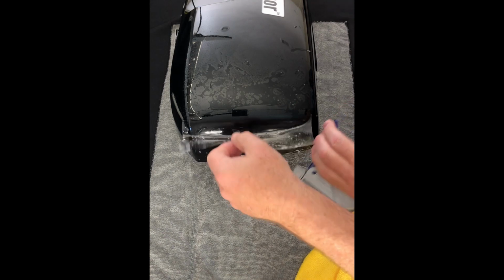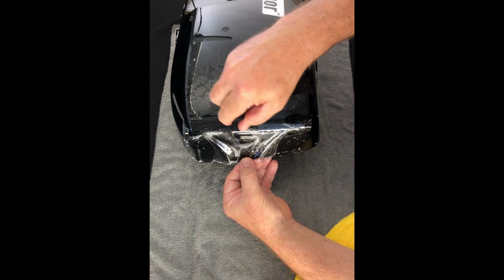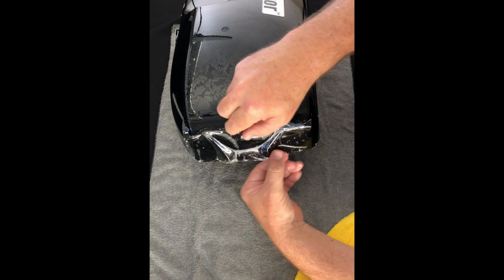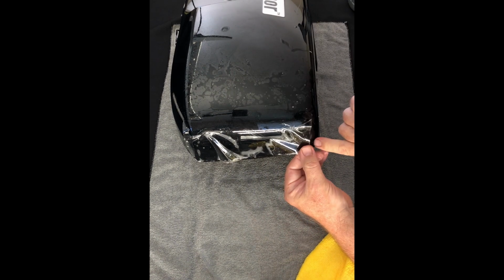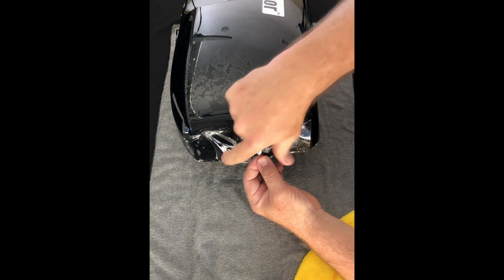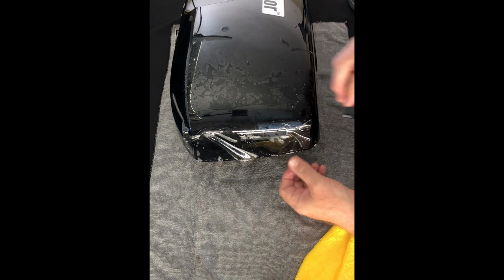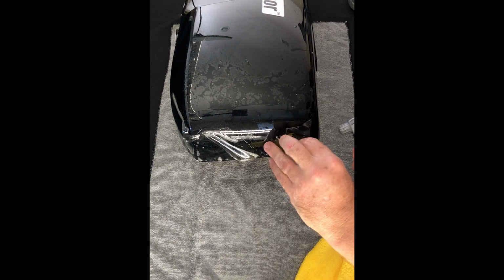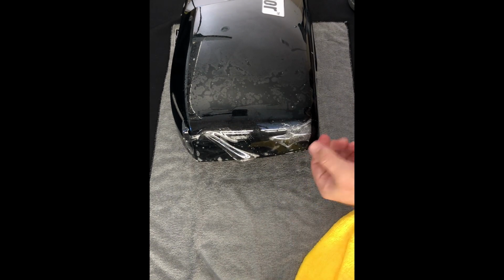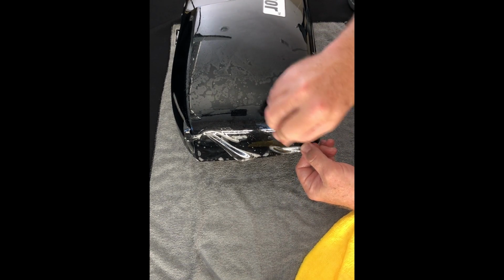So we're going to get her wet. Just go ahead and squeegee it down again, thinking about ending everything at these points, remember? So you don't want to gap it up so you end up with a lot of material in the middle. You want that down and then work your way out towards these points. We'll use a little alcohol right here so that when we stretch it, it's going to lay down over here.